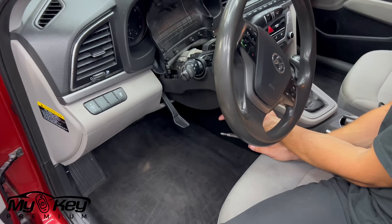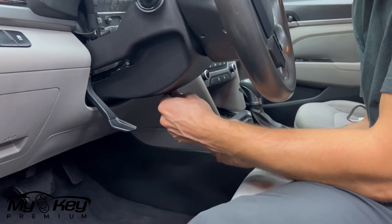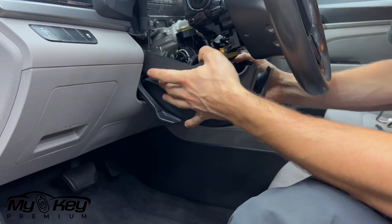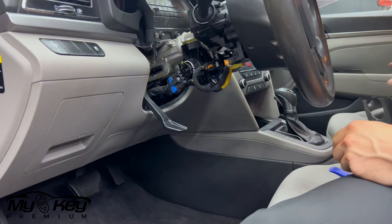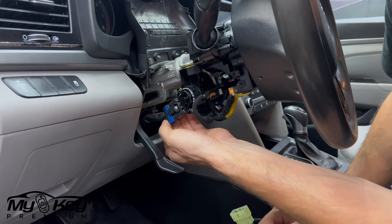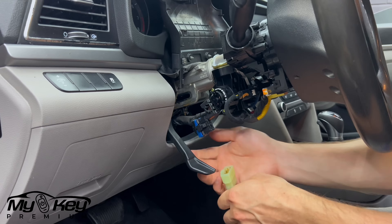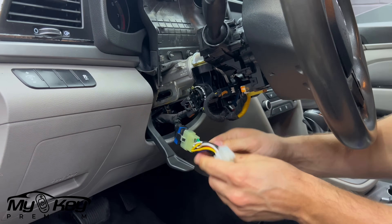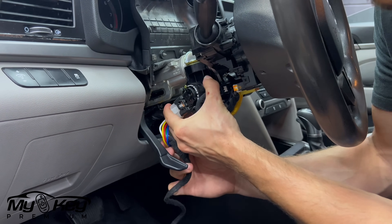And one on the bottom, which is right over here. Get the bottom panel out. Now the second T-harness — we're going to unplug this, plug it in here, and put it right back into the car's plug. To do so, raise this pin and with your second hand pull it out. Now connect it into this connector — make sure it's all the way in — and the other side, plug it in.